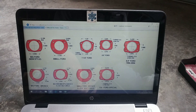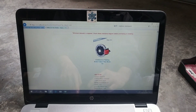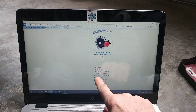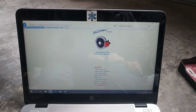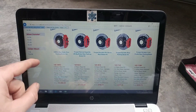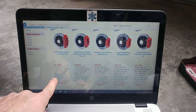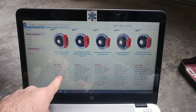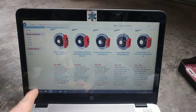Selecting the 94–04 option brings up a combination parking brake kit: a 12.8 inch rotor with a flange for the 94–04 housing and an offset of 3.25 inches. The wrinkle between the two housings — 79–93 versus 94–04 — is this offset. The 79–93 8.8 has an offset of 2.5, while the 94–04 has a 3.25 offset. So now I need to measure that to see which one I actually have.